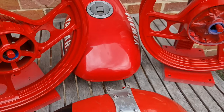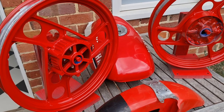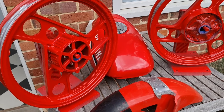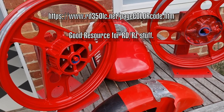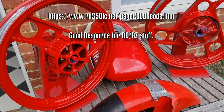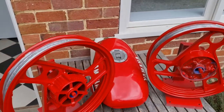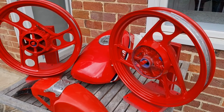I think that's come up a pretty good match given that we don't have color codes. Color codes are impossible to find — the easiest thing is to take an original part to your paint shop and hopefully they have a camera that can detect the pigments and color match it for you. Even when I've found color codes online, like cherry red, local paint shops have never heard of them and can't find them in their databases. Anyway, it's come out quite well — we'll let them dry and harden off for a couple of weeks, then put the bearings and discs back on.